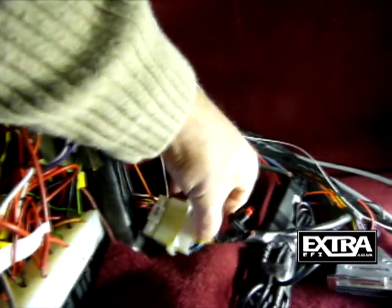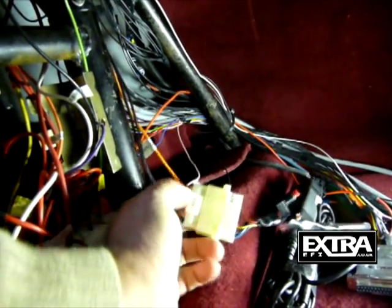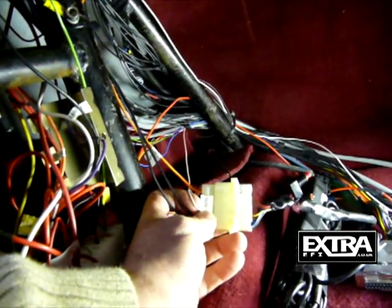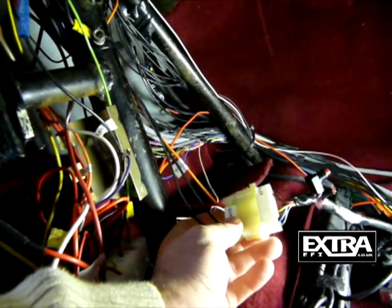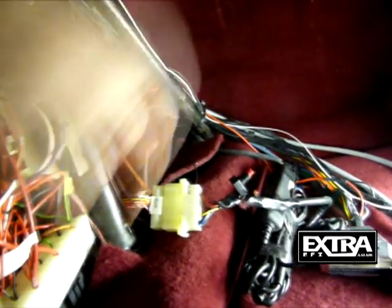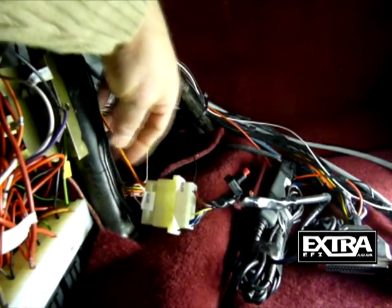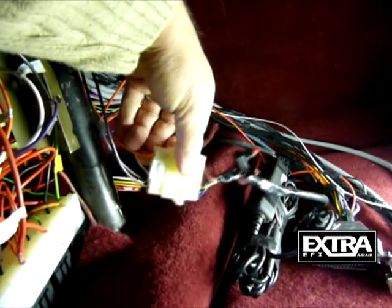The output is on the yellow wire of the Innovate. Output one is on the yellow wire, and that goes back to the pink wire on my MegaSquirt wiring loom — that's the signal back to the MegaSquirt to tell it the voltage output from the wideband lambda sensor. I've also used the brown output, which is output two, and that goes off to an AFR gauge on my dashboard.